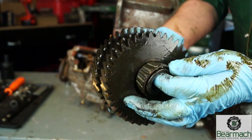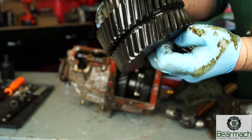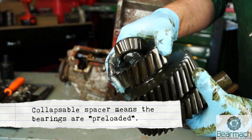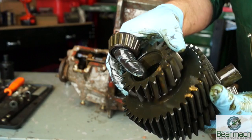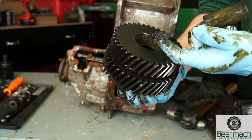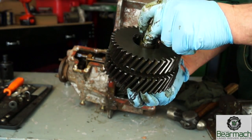This is the intermediate gears and it has two taper roller bearings. It also has in the middle a collapsible spacer. This is why the gearbox is the 230T - the T denotes taper roller bearings. In the centre here you can see this sludge, which is responsible for component damage, so we need to check the bearings on this one.